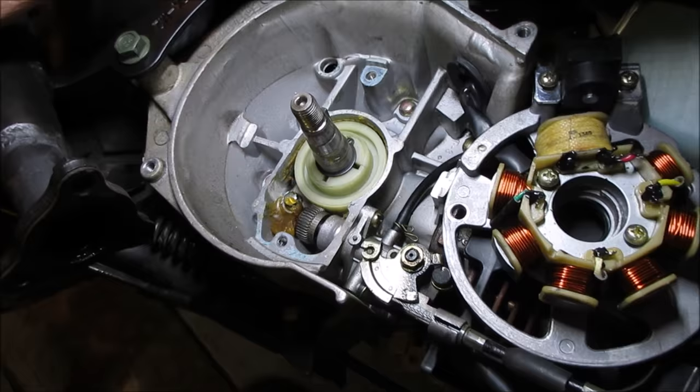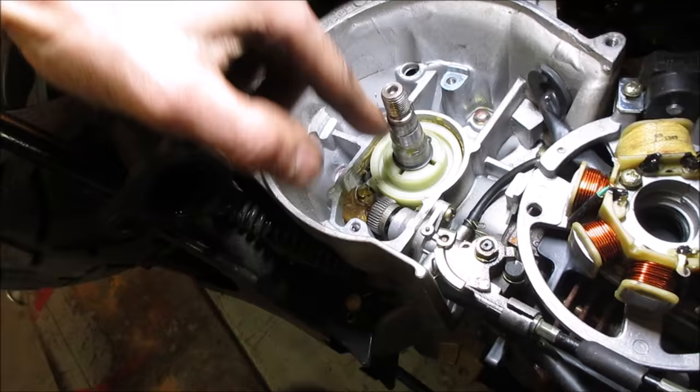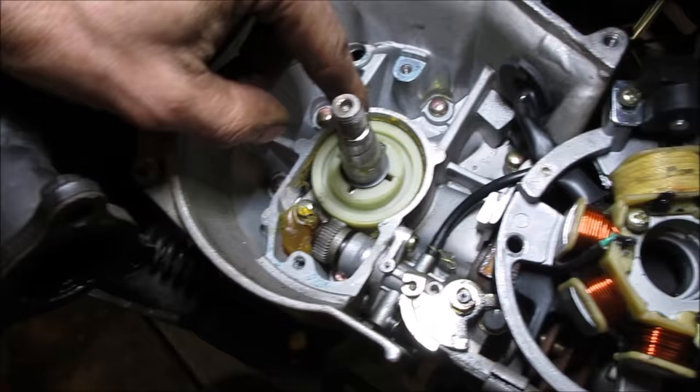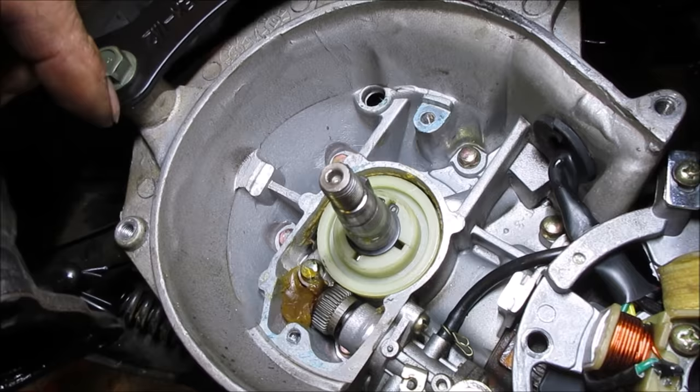I don't think we're going to be able to get those screws out to get this up out of our way. It's got a locating pin. Let's see if we can get that snap ring off of there, and see if we can lift straight up on that and get it out. Should be able to see the seal behind it. I don't suspect this side is an issue. It's looking pretty clean, but we're this far, right?